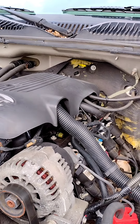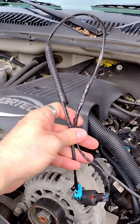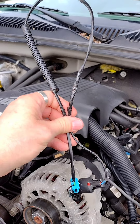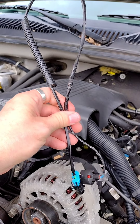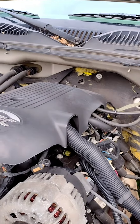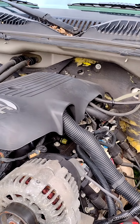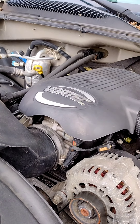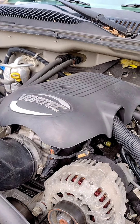One sensor was still working good, so I tried the trick some people talked about — the single wire. I got a new harness, combined it, and ran it on that for a while. That lasted about two months and then it went bad. So what I was figuring out is it all comes down to the resistance on these knock sensors.